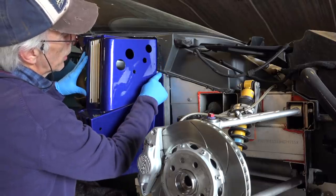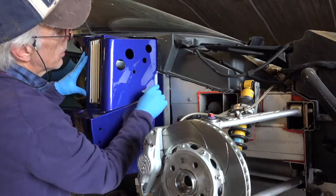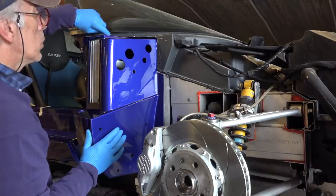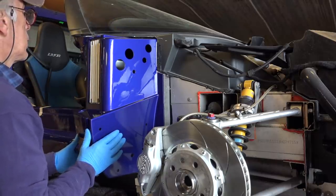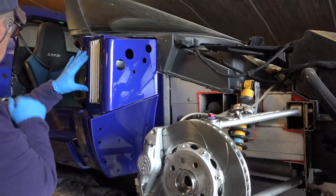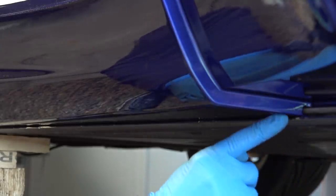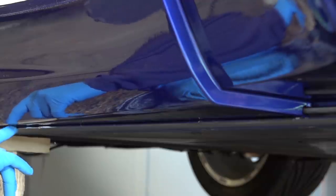With the sill almost in place for trial, I need to make sure it fits correctly at the end — this is the part where we had to cut out a piece of the original sill because it was mounted underneath. Here at the end we'll have to fix another bracket to cover that corner. Up on top we'll have to put a lot of polyurethane bonding on because there's a considerable gap. You can't really push it any higher. Around the door hinge everything should be fine. At the bottom of the sill there's a quite deep groove which we have to fill up with polyurethane glue — it's very important the sill fits in there properly.